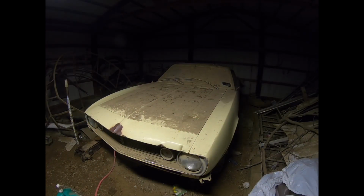All right, it's much later. The belt I brought fit perfect, and the radiator line, the top hose, fit perfect also. I'm really surprised that worked out for me, but here you go. After I let it warm up for a little bit, it starts up and runs by itself pretty well. And I haven't done anything to the carburetor other than pour gas down it. But you get the idea.